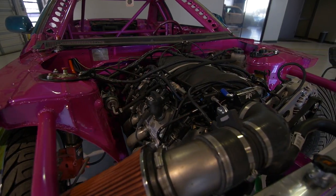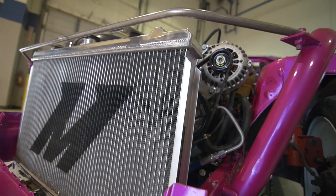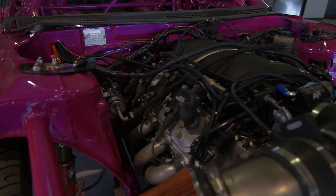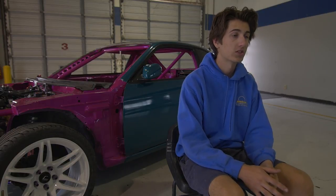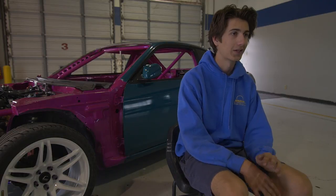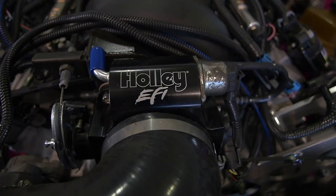The new heart of the drift car this season is an LS3 525 motor from Chevrolet. The motor comes fresh with hopped-up heads and a cam to make 525 horsepower. We have a Mishimoto three-row radiator in the car to keep it cool. We have a full PSI harness. The car is staying throttle cable — not fly-by-wire — which is really good. I hate fly-by-wire. We also have a Holley throttle body on it to keep it throttle cable.